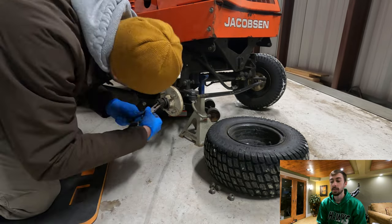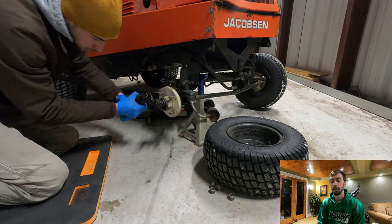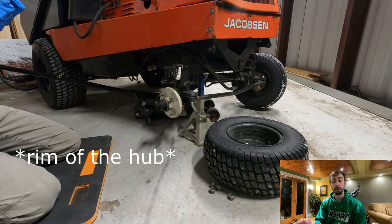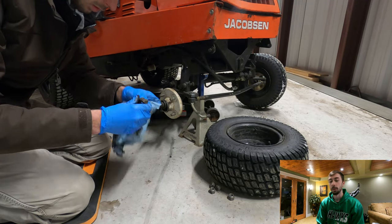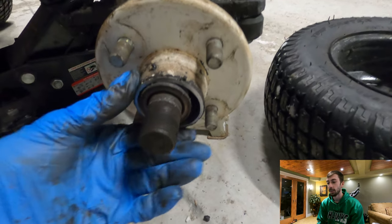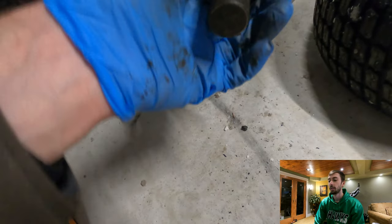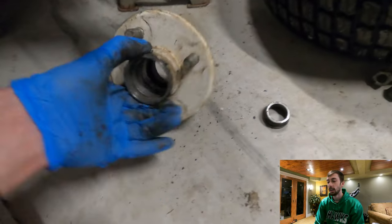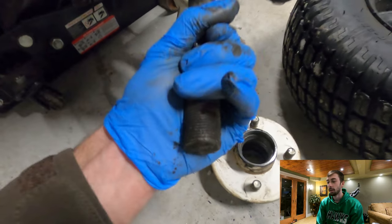There were two races left on the axle and one race left in the hub assembly. The races are what hold the bearings in — they stay solid on the rim of the tire and on the axle, and the bearing is the part that spins in the middle. The first race came off pretty easy, and so did the hub assembly, but the second bearing was pretty tough to get off. That's just because there's no grease on it — plain and simple. It was pretty bad to work with.